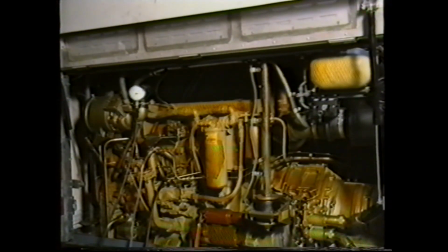In the first category, the engine will be down on power, and in the second instance, the performance will be normal. Therefore, to avoid unnecessary checks, always identify the category. Let's first of all look at black smoke with normal power. First, check the fuel pressure.